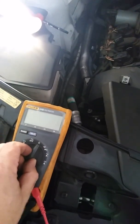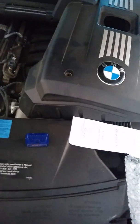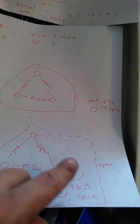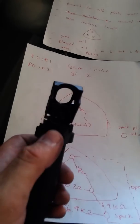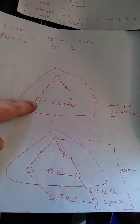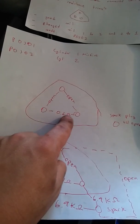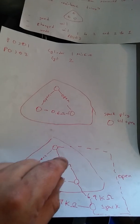I went ahead and used the multimeter set to ohms to check the pins on both a good coil pack and the bad coil pack. On the good coil: top pin to bottom-left pin was open — in the mega-ohm range, very high resistance. From the middle to another pin was 0.6 ohms, low resistance, and from another pair it was open. I also checked the spark plug output pin to each of the other pins and all were open.